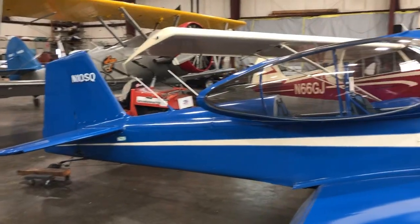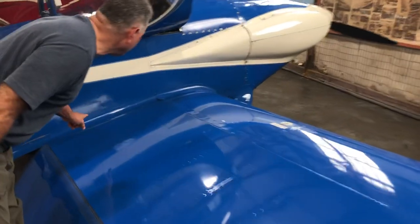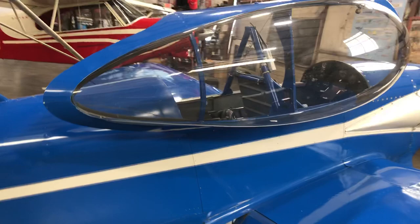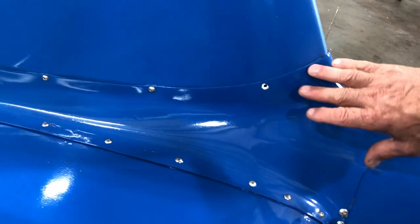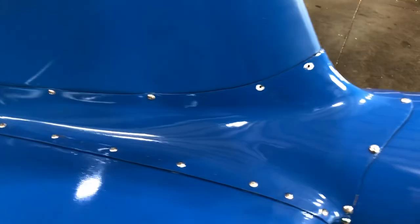The second worst thing about the airplane is the fairings. The fairings on the other wing have these flush screws mostly in front, but there are ugly sheet-metal screws in back that kept getting progressively bigger. If I was going to keep this thing, I would slowly nut-plate these and get them back to prettier-looking screws.